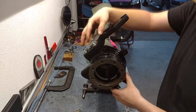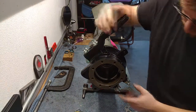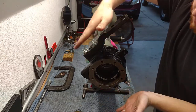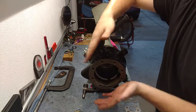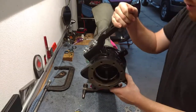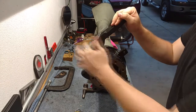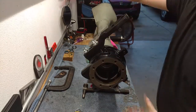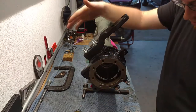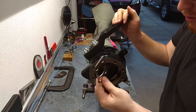I need to reduce the amount of thickness between the steering arm and the knuckle, and the bearing cap and the knuckle. That will bring these two parts closer together and put more pressure on those bearings, increasing stiffness. Got it all torque-spec — it's not right. Got to take all eight bolts off, take these two caps off, remove those shims, and put in a thinner shim. We'll probably step down to 32 thousandths.